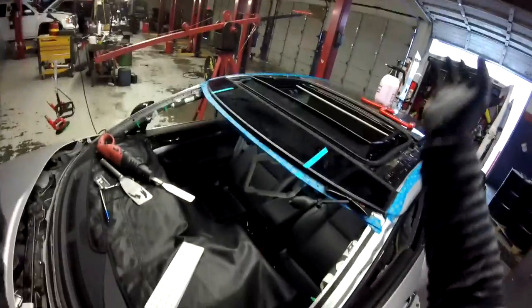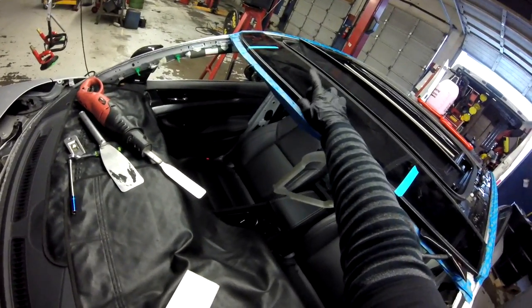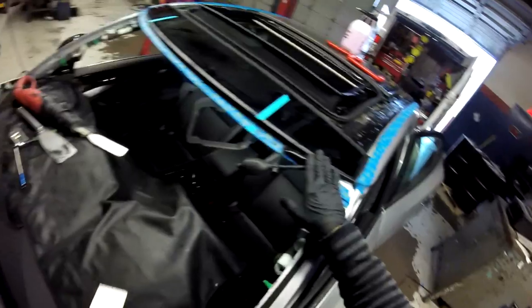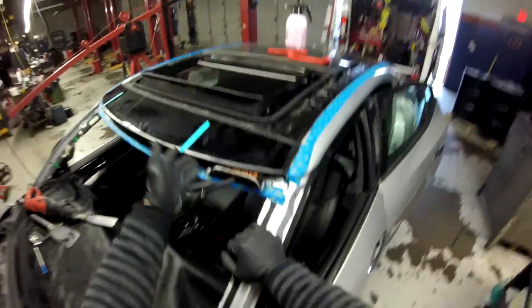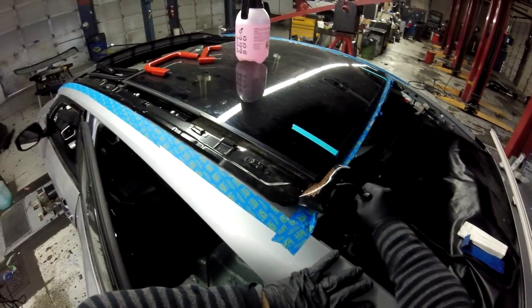There's like a bracket just holding the frame, and the guide over here is a pin about this big, the guide for the frame. So what I do now is open it with my stick like this, insert my wind bag, and now I'm going to start pumping. And what I do is raise it right there. No more, because it's going to break. Remember, the glass. So just be careful right there, and I'm going to lift this one.